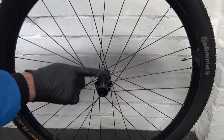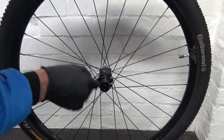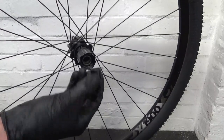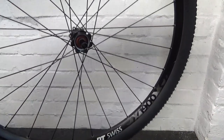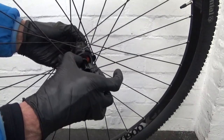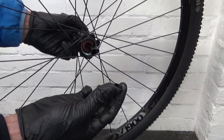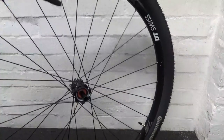You're left with the freehub body inside the cassette — that's not a problem because you're after the wheel bearings. Pull the freehub body off, then you've got the end cap. Just pull off the freehub body like so, and then just inside there remove the spacer collar — put that to one side for cleaning. You can see the bearing in the end there; that's the drive side.